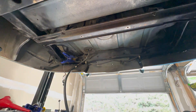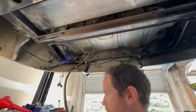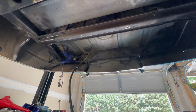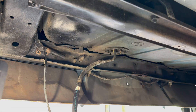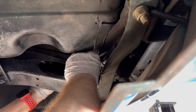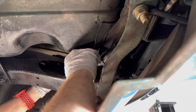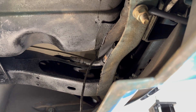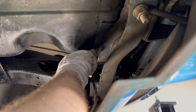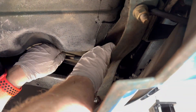While the tank drains, I've gone ahead and cleaned up some of the not-so-great wire connections from the stock harness. The metal fuel line that runs to the engine bay goes through the frame — there is a clamp just out of view here that's worth removing to make your life a bit easier. When you install the new hose, make sure it's rated for fuel injection and you use the appropriate clamps as well to avoid leaks and complications.